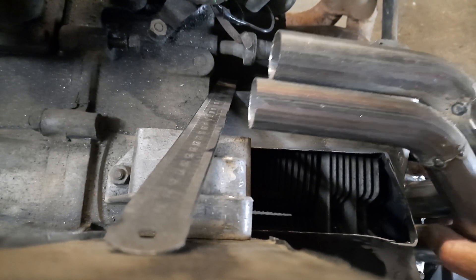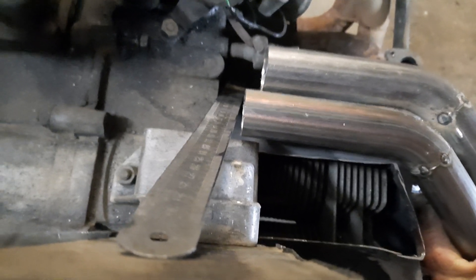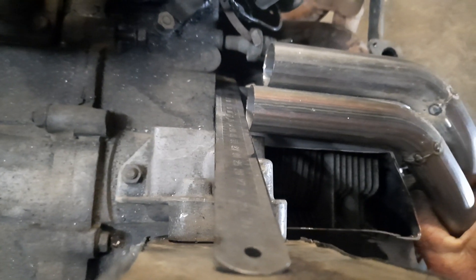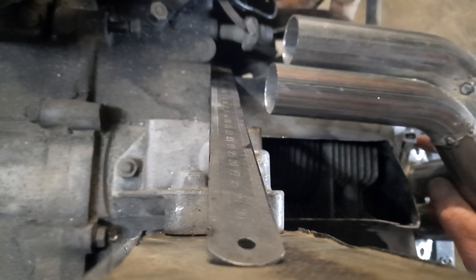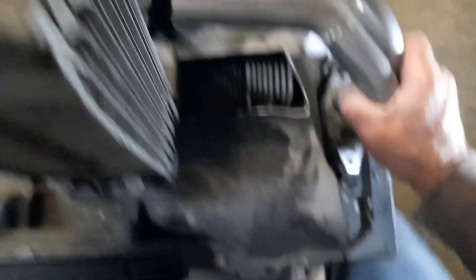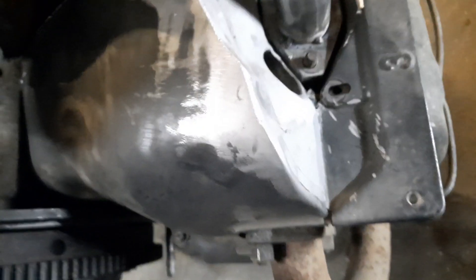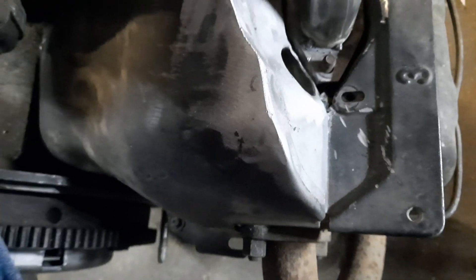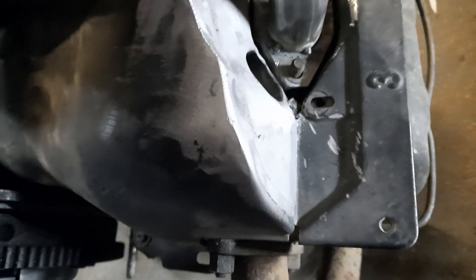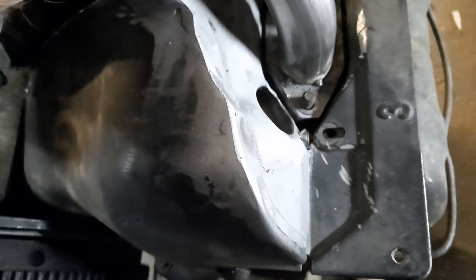What I'm getting at is that if I'd made all this, joined it all together, fitted onto the studs, I wouldn't be able to get it off, because it has to be able to come straight up. When it's one piece it can't spread out. So which means I've got to pull these studs out and put bolts in them, which I prefer not to have to do, but I don't really have any other option.